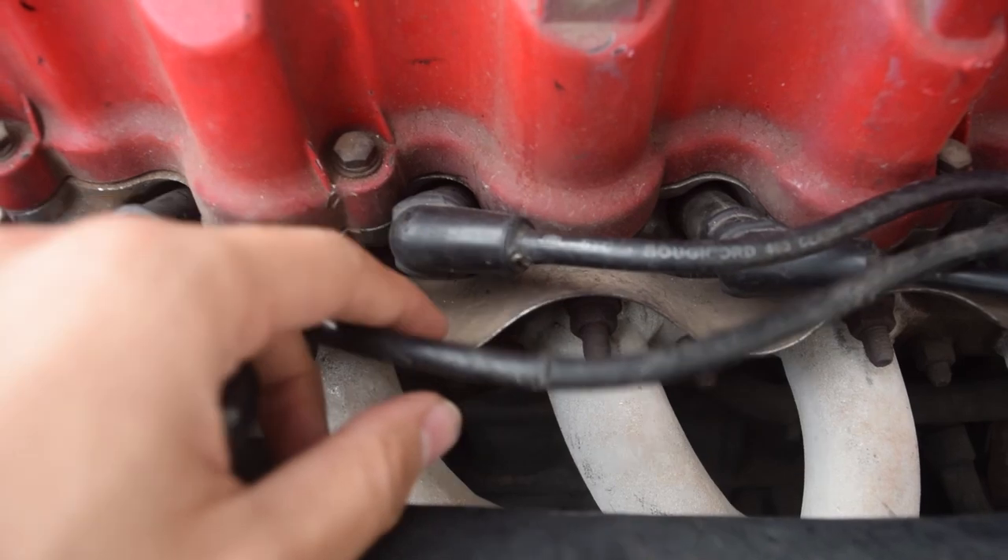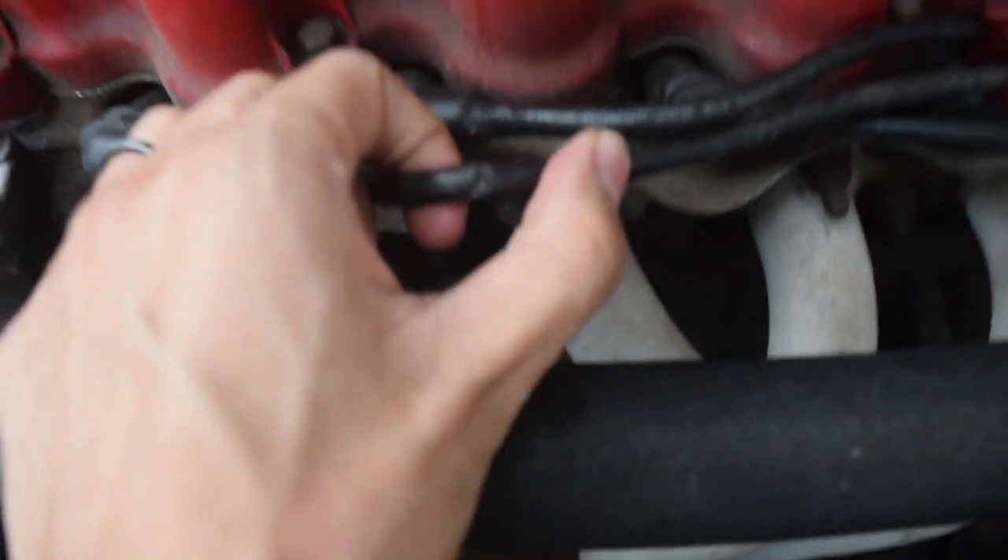Let's talk about today's installation. When I went for a drive and did a pull around 4000 RPM, I lost some power. When I came back I checked everything - coil packs, spark plug wires, and the spark plugs themselves - and everything seemed fine. But as I was wrapping up, I got a shock from the spark plug wire on the first cylinder. Closer inspection revealed it was cracked - possibly chewed by mice. The car is around 15 years old so things are bound to get brittle. OEM replacements are available and it's a very easy and inexpensive fix. Leave a like if you found this helpful and I'll see you in the next one!